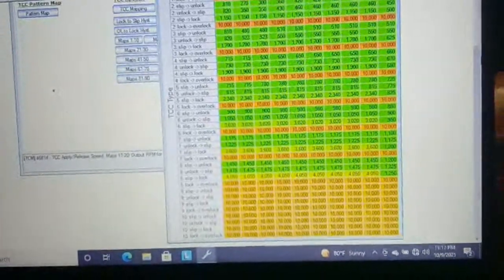So you start getting into that, and you go to a different converter, and sometimes you start changing that up, and you start finding that changing it up doesn't really make that big of a difference, and so you just leave it unlocked and call it good. You can start getting into the nth degree with some of these things, and it can get to a real, real headache, honestly. But these are all output shaft RPMs, not engine RPMs, usually. Because engine RPMs aren't at 220.